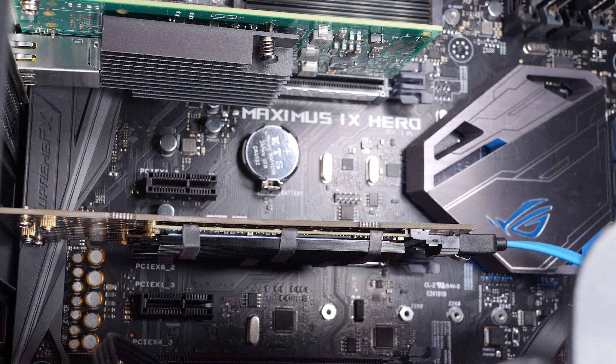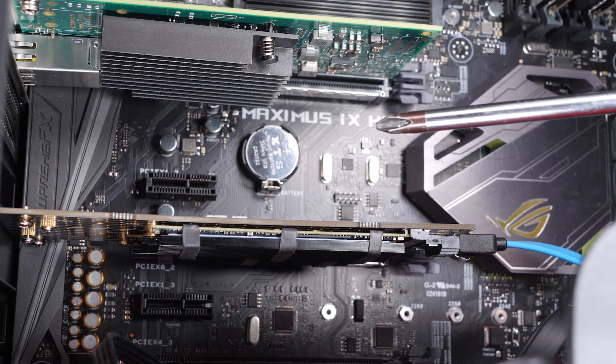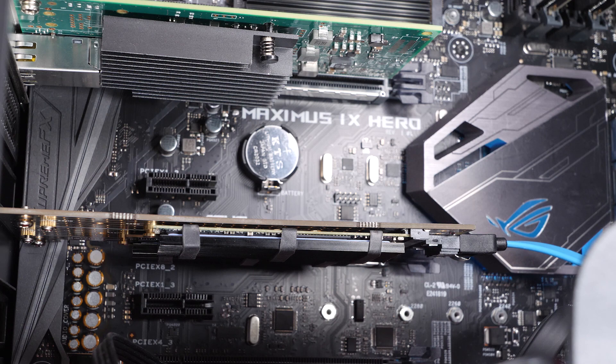As you can see, I went ahead and mounted this card — you can see the SATA port plugged into a free port on my motherboard, and it's inserted into a PCIe slot. You can use anything above x4 — so x4, x8, or x16 — it's only going to use x4 lanes anyway. I'm running it in an x16 slot but only using four lanes, so it should be fine. Let's fire it up and run it through some testing.